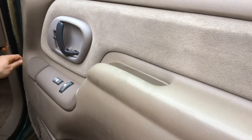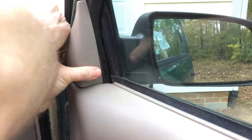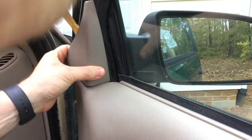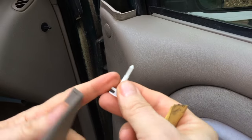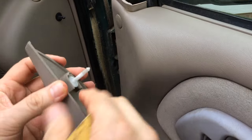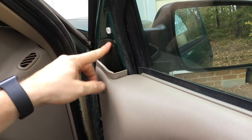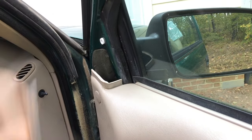Sometimes you might even find that some of these things are broken off and you have to replace them. You just go all the way around popping these off, and then when you get to the very top here, this one's going to be its own unique piece. So we pop them off separately. They're just a little rigid nylon piece. If you break them, you can get them from GM or at any auto parts store. There's nothing real special about them. There's this piece and then there's the piece that inserts into the actual metal frame of the door.